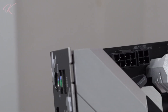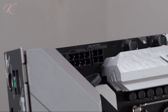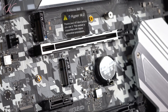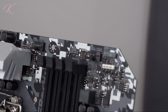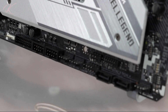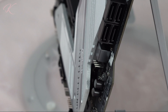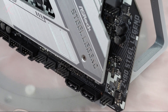There are 8-pin and 4-pin CPU power connections on the top edge of the motherboard towards the left corner, which makes it easy to access. The rear chassis fan sits just above the PCIe x16 slot, while other fan headers are grouped into two areas — the CPU and optional CPU headers are along the top edge, and the chassis fans are located along the bottom edge. Four SATA ports are found on the right edge of the board, and there are two SATA ports along the bottom edge oriented vertically.